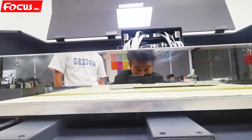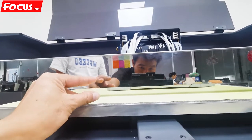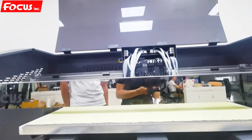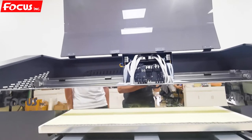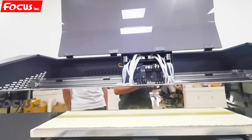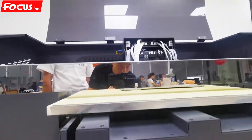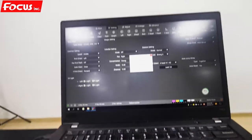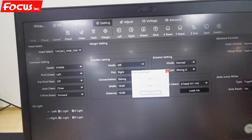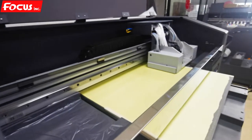For safety it is better to double-check with our eyes to check the gap — make sure it does not scratch the print head. The gap between the print head and the media should be 1 to 2 millimeters — not too small, not too big. If too small, it will be easy to scratch the print head. If too big, the print quality will not be good. After we confirm the gap is safe for the printer, we go to the software, click the control panel, and press X reset, then the carriage goes back to home position.